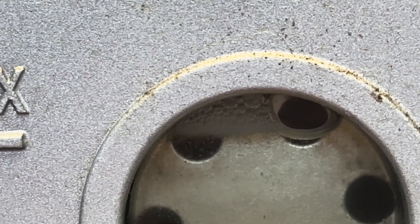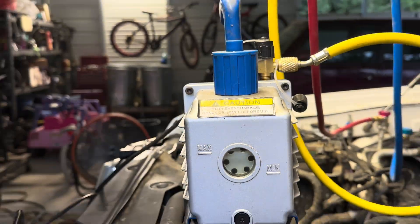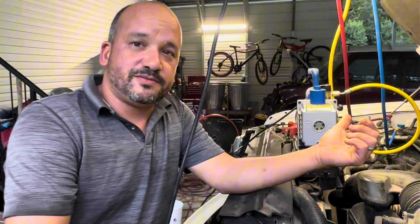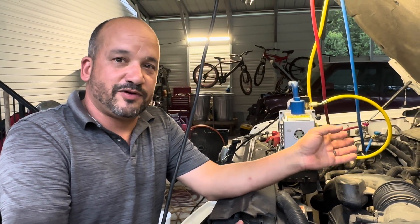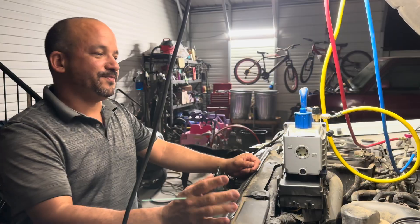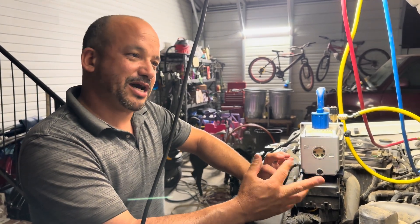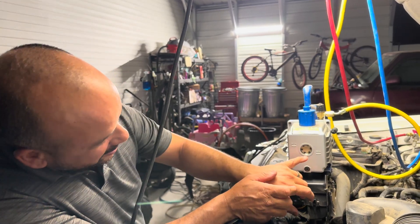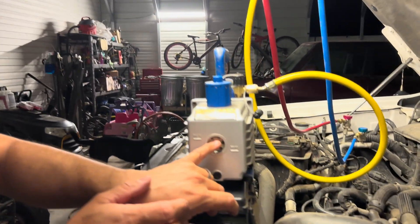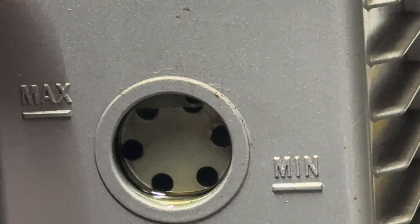It's been about two hours later — I meant to keep it on for 15 minutes but got tied up doing stuff. I'm looking here and there's barely any bubbles at all. There are no vapors coming out. So before I shut this off, the system has been running long enough to get all the moisture out.